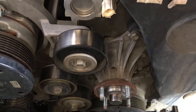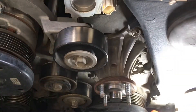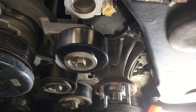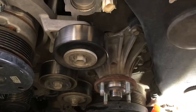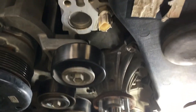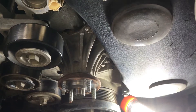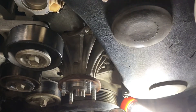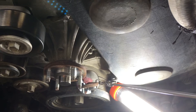I just want to give you an idea, so I'm going to put the torch down underneath - it's going to get in our face a little bit. On this one we're doing a timing belt, and we're doing the water pump as a prevention, even if it wasn't leaking we were going to do it anyway. But when you pull it apart you get to see more. So we've got the torch there, I'll send the mirror down underneath the water pump - and there you go, you can see the reflection of the mirror there. You can see all the pink coolant.